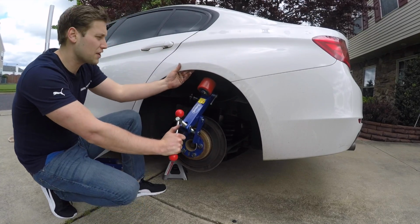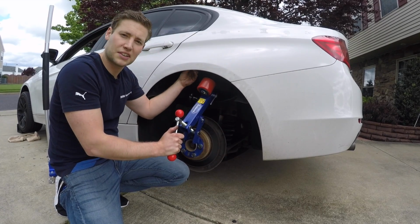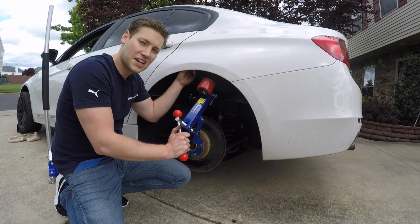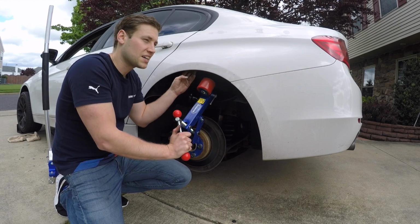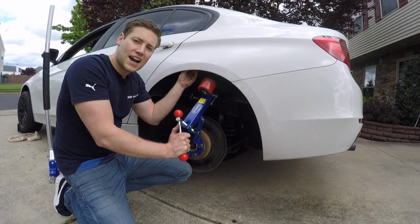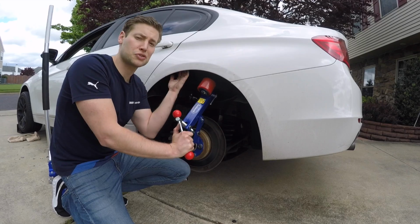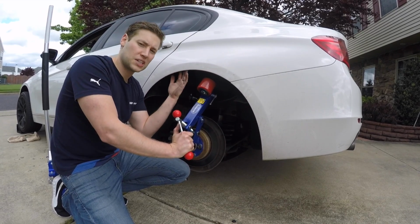Now the inside of this fender isn't perfectly flat. There are actually 2 pieces that look like they're tarred together. BMW uses this weird tar stuff to kind of seal the pieces together. So we're going to try and leave that there. I have seen where people actually Dremel it out, and then they go back, roll the fender, and then reseal it.